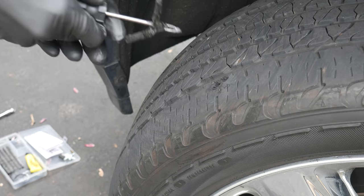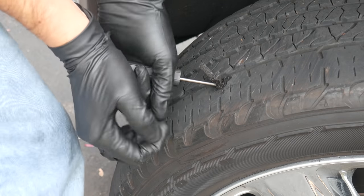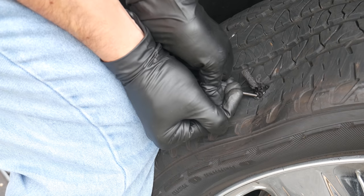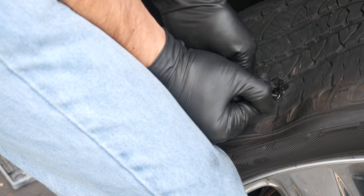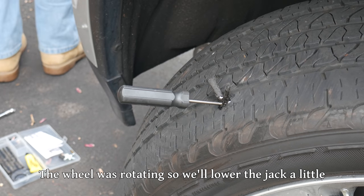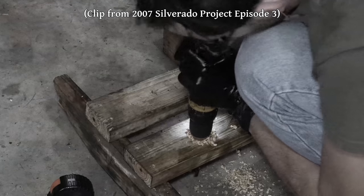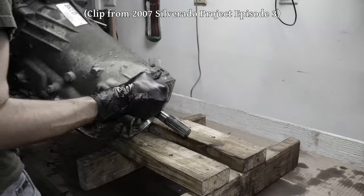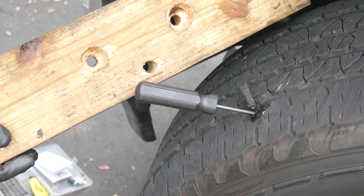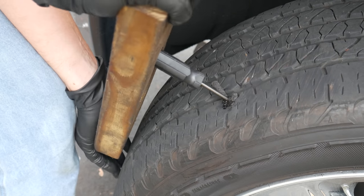Now all we have to do is press the plug through the hole in the tire. Easy, right? Well, no — this is usually actually the hard part. If the hole isn't too big to be patched and you didn't drill it out too far, it should be pretty difficult to install the plug. It's going to require a fair bit of force no matter which tool you have, but with a straight-handled tool like this, it's pretty hard to apply enough pressure by hand — which is where this nifty little 2x4 comes in. The holes drilled partway through are just the right size to fit the handle of this tool, and that'll let us really put a lot of downward force on this thing to get the plug fully installed.